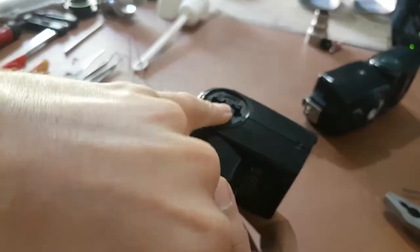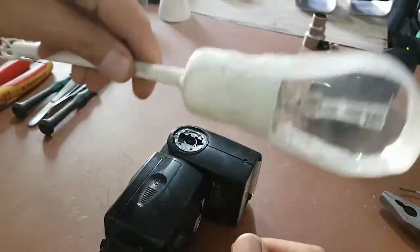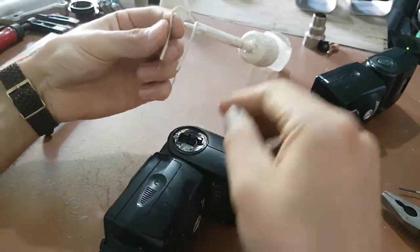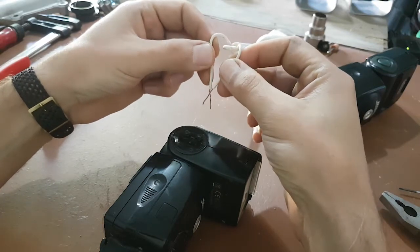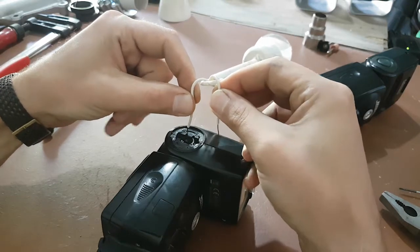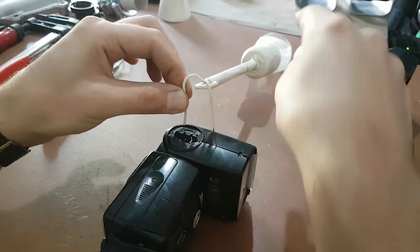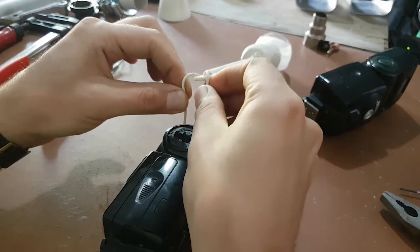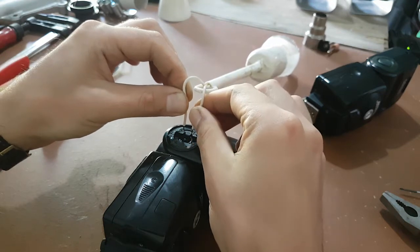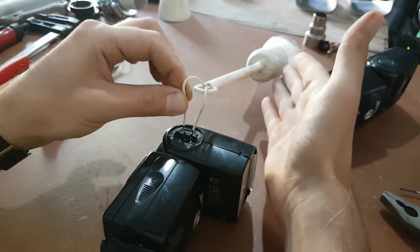With the help of these two holes, you can discharge your capacitor. You get that discharge tool — the bulb — and stick the ends inside these holes. Of course, don't touch the metal and don't short circuit them. While you discharge, there can be a small spark — that's very normal, don't get scared, though I did get scared. Watch out. The bulb will light up and then fade — the capacitor is now discharged. Don't be fooled just because the bulb is no longer emitting light.